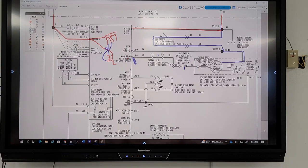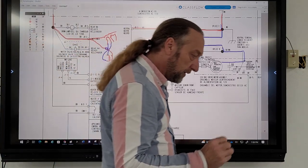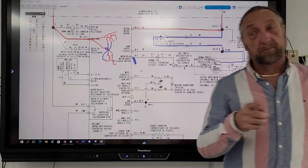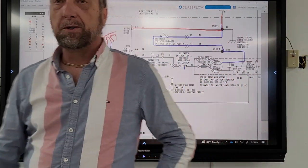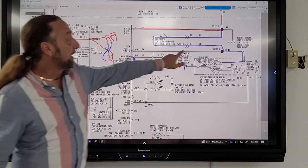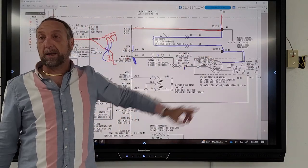Oh, okay. Wait, hold on. I'm looking a little bit. This is the relay board. The relay is clicking. It's telling you that it's getting power. Yeah, J91. If the relay is clicking, it's telling you the coil has got power. It doesn't tell you the switch is carrying power. Then you test the relay. Nope. What I would do is I would put my other lead at J4, because this is neutral, and this is power coming in.